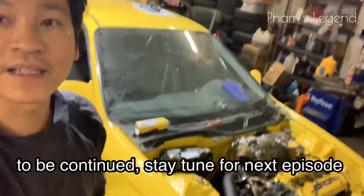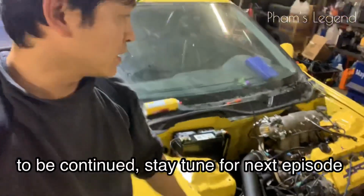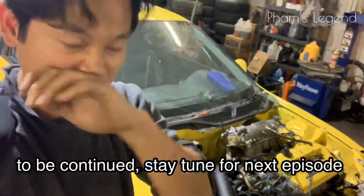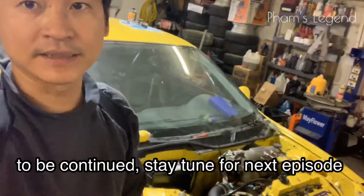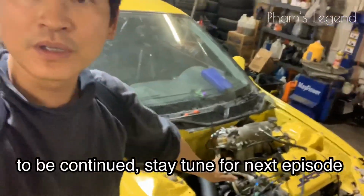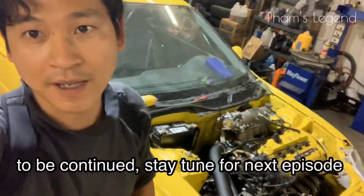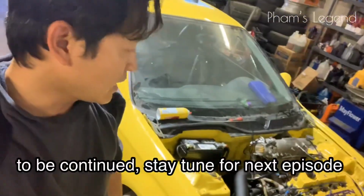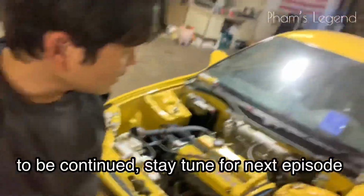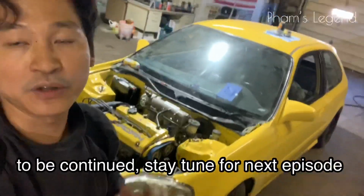We put everything together and we're trying to crank up, and the car is trying to start, but at first we got no compression at all. We adjusted the valve, so now we got compression, and we have to figure out the spark and the fuel, and maybe change the spark plug again, because the spark plug is fouled already since it's been flooded. I'm gonna end this video right now, and we're gonna make it start and do the next video.